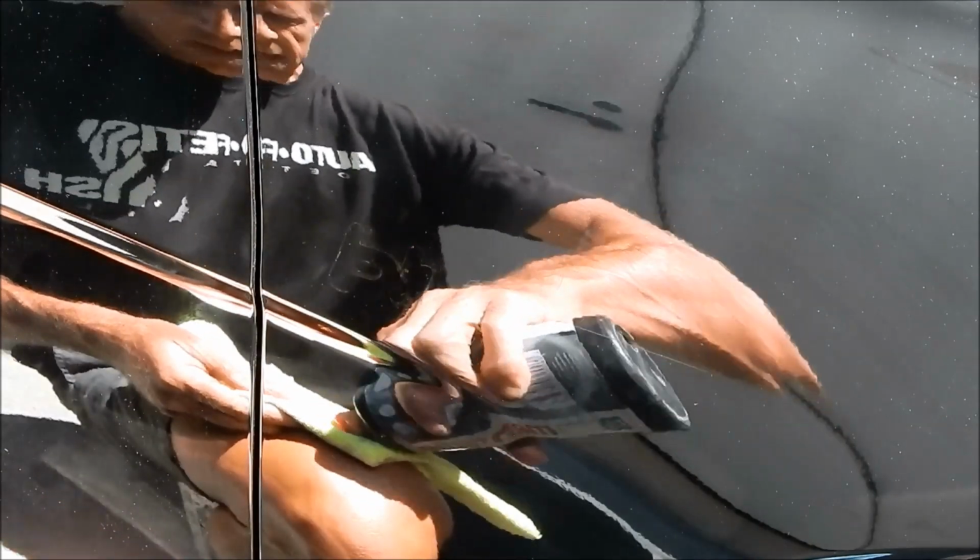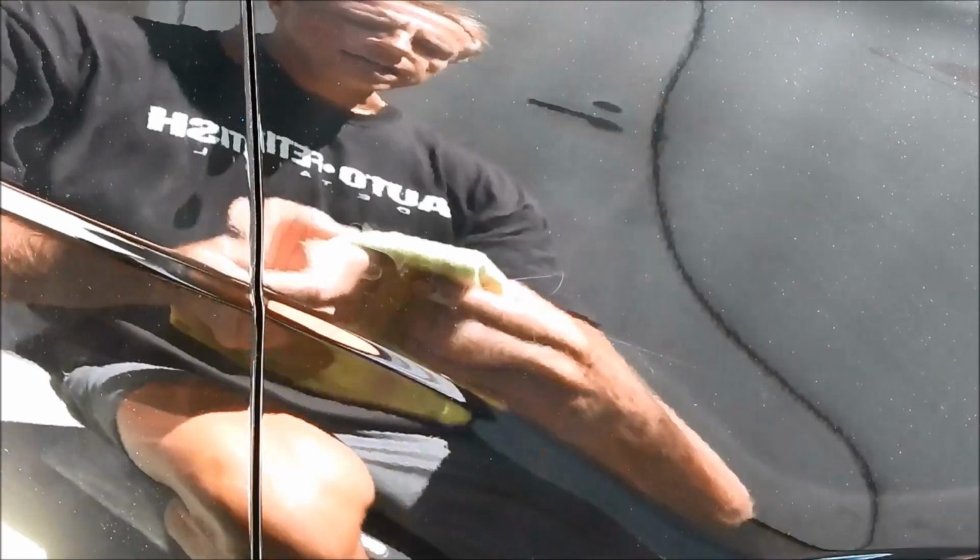Not all polishes, even these retail car paint scratch removers, really have any abrasives in them. See when I do this, that effect, that kind of reverse shadow effect, tells me there's some residue of some kind. Just because I can't feel it with my fingers does not mean it's not there. That's very revealing, the fact that shadow instantly appeared as I rubbed over it with this polish.